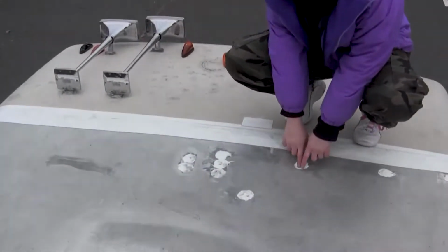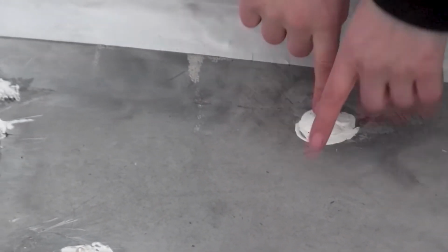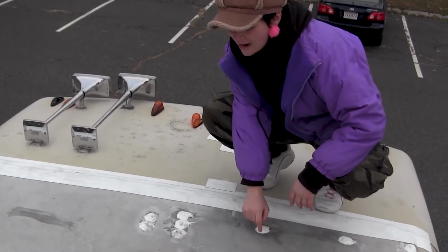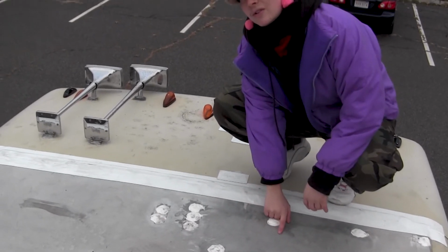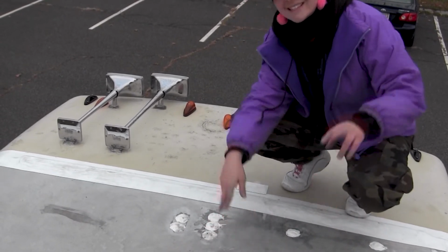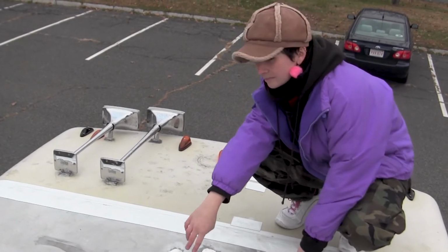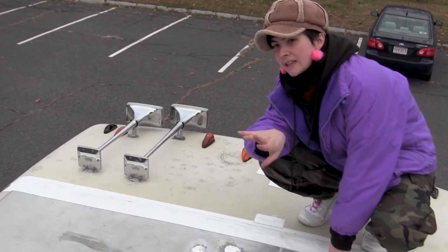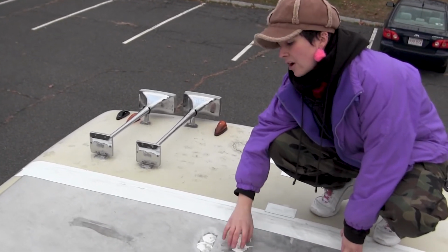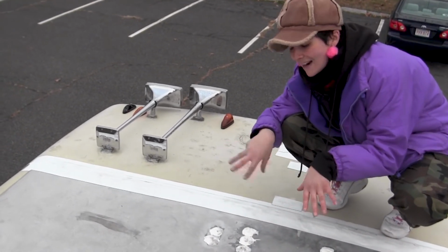This white gunk is the other kind of caulking that I used, and this is called Dicor Lap Sealant or Dicor Lap Roof Sealant, I don't know, and I'll link it in the description, obviously. But this stuff is self-leveling, which is the coolest thing ever. So instead of becoming a weird clumpy mass like the black stuff does, it quite literally self-levels. You put it on and it's like this clump, and then it flattens out.